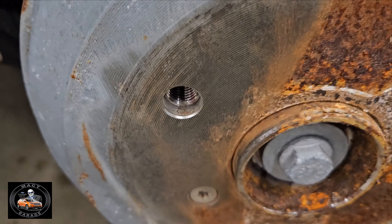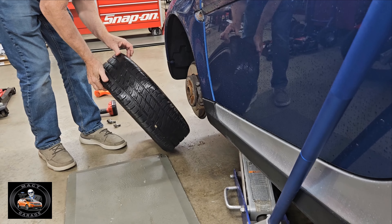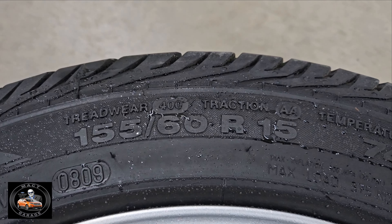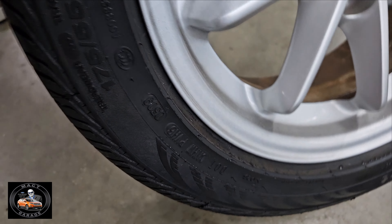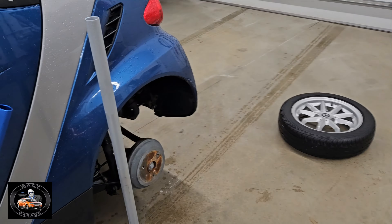There we go folks. A little bit rusty so I'm hitting it up with this brush. We're cleaning up this Smart For Two. We're changing the wheels because they put the front wheels on the back and the back wheels on the front. Believe it or not, the tire is slightly wider for the rear and narrower for the front. The front tire is a 155/60R15, and the one that goes on the back is a 175/55R15. So we want to put the bigger tire on the back because that's where the traction happens.